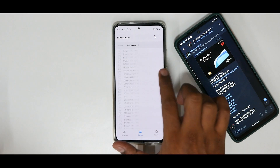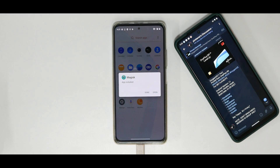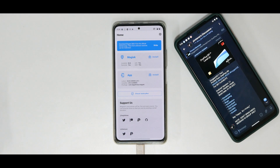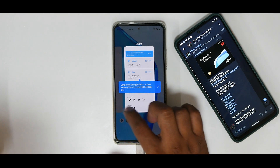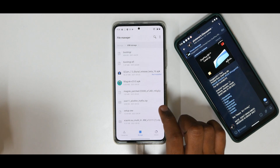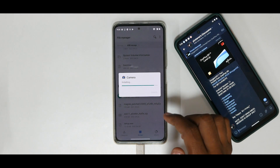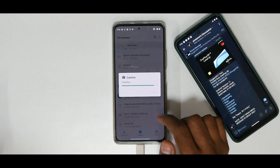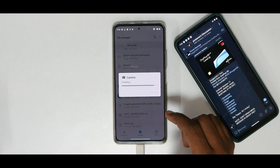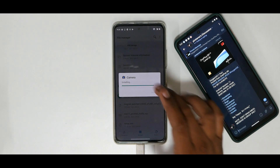Go to Storage and USB Storage — first install Magisk. Open Magisk. Flashing Magisk through the conventional TWRP method doesn't work, so we have a patched boot image linked in the description. There is also a hotfix and a GCam APK linked in the description — you can use this GCam or any other GCam because the built-in camera application is not working even after giving all permissions. The camera works but some things don't — we'll discuss that in first impressions. For daily use: 4G, Wi-Fi, and Voice over Wi-Fi are working absolutely fine.